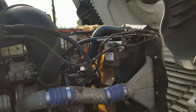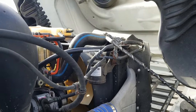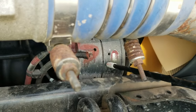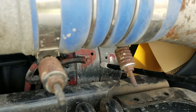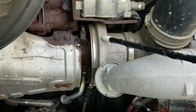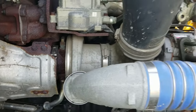On the right side of the engine, the first thing I want to check are my hoses. Make sure there's no loose or missing clamps, no leaks, no damaged hoses. Then I'll check my alternator to make sure it's securely mounted, no loose or missing bolts, no broken or frayed wires, and it is belt driven. I'll check my exhaust system to make sure there's no holes, no leaks, no soot trails that would indicate a leak. I'll move over to the left side.